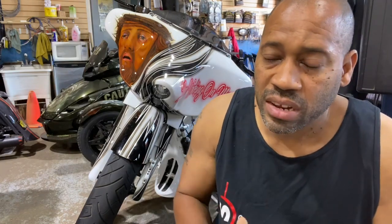The reason the client is having issues, and the battery voltage is dropping into the 10s after only 30-40 seconds of playing his music, is the bike was rewired. The wiring job was clean, but they used copper-clad aluminum wire. They did not use good wire, so the bike was not able to supply the amount of current that the amplifiers needed to do their job. So that was the first problem.